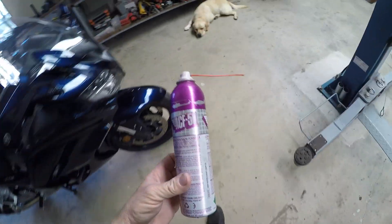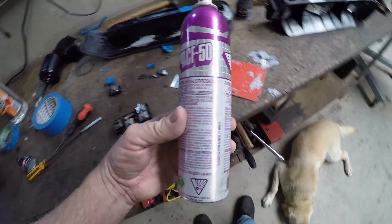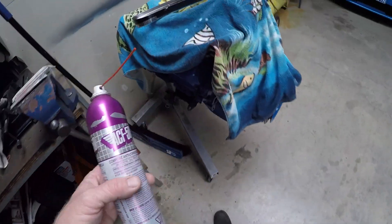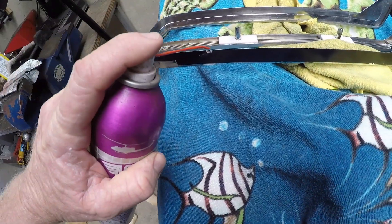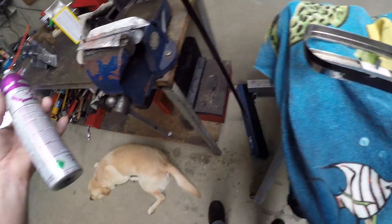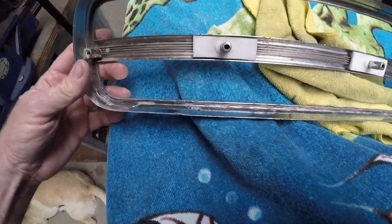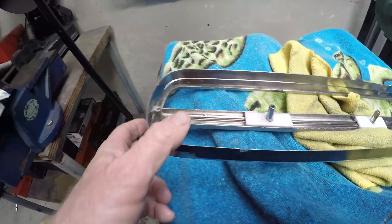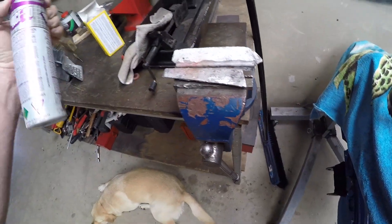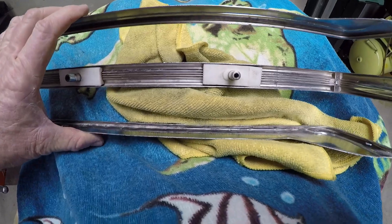You can get this from a motorbike shop, or from Spruce Aviation. Just literally spray it on — wherever you spray the stuff, it will stop the corrosion in its tracks. It's not a repair, obviously, but again, you can't see this on the car because it's all hidden away. But you do need to stop that corrosion. This stuff stops the anode-cathode process — pretty much it'll last forever once you put it on. It says two years on the can, but it will.